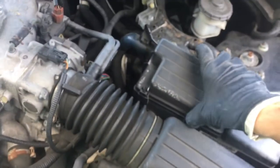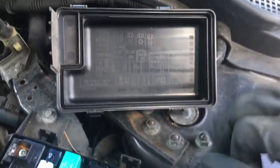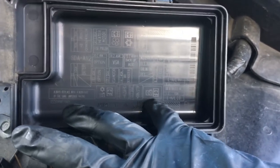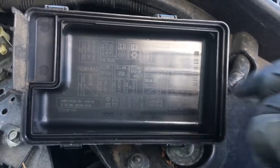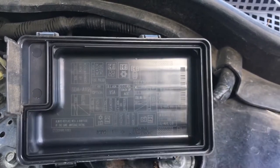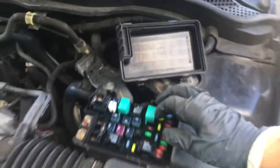We have nothing. Still have nothing. So who's my culprit? Since it's a Honda or Acura, we jump to our tried and true — eight out of ten times it's this. Right there, you see that snowflake? That one's for the fan. You have a fan fuse plus the little snowflake label for the MG clutch, and then you have just the snowflake by itself between these other two — right there, that's our culprit.